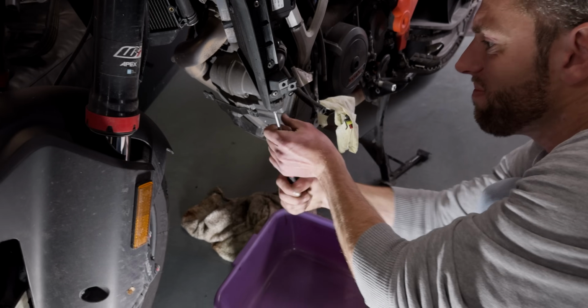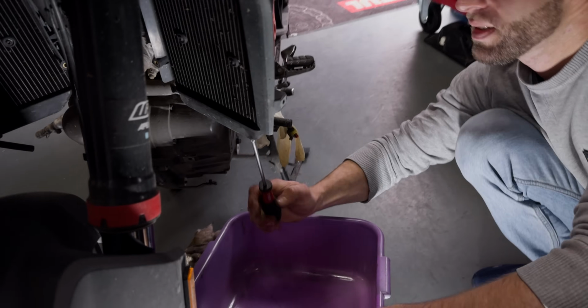So far, we've removed the tank assembly, and the throttle valve assembly has been taken off. So all the stuff on the top is already removed. So the next step is to open up the engine coolant. We have to drain the coolant liquid out of the system. That's the next step. This is one of the radiators. This model has 2 radiators.